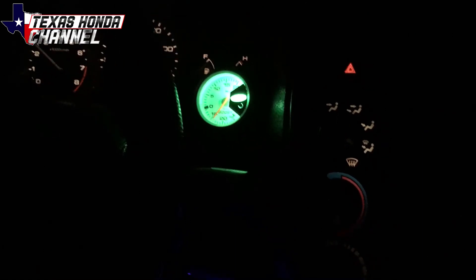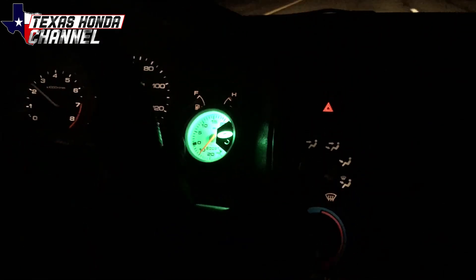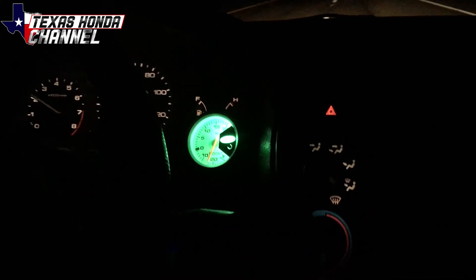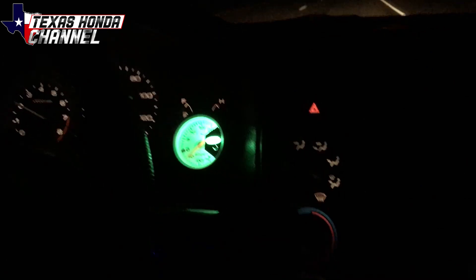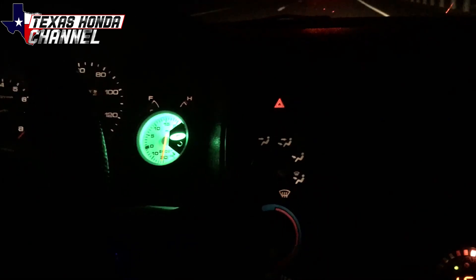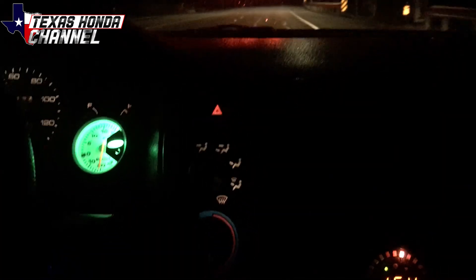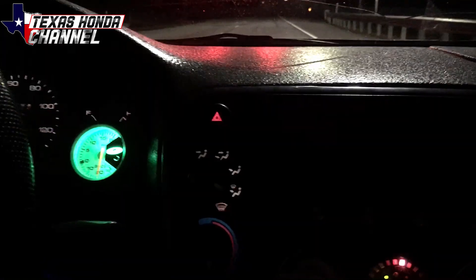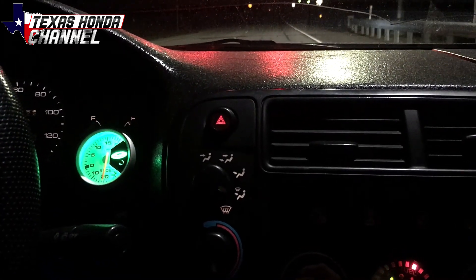So it hit 12 and a half at its peak. Pulled really good, but my clutch no longer can keep up. I'm pretty certain we're over the 200 mark, because last time we dynoed it was like 194. We took the air filter off at 200, so it's doing really good, but now I think it's time for an upgraded clutch. We prefer to go with the six-puck stage three from XTR or XTD — had really good luck with them all the way up to 18 to 19 pounds, and they did really good. It's pulling really, really good.